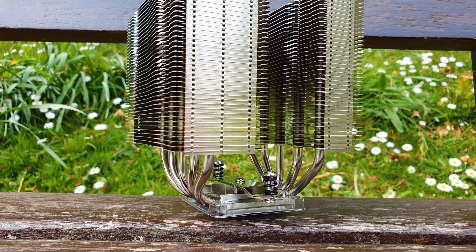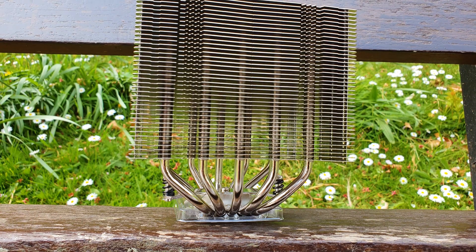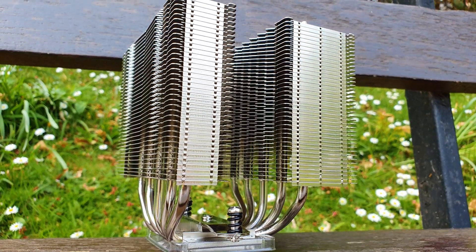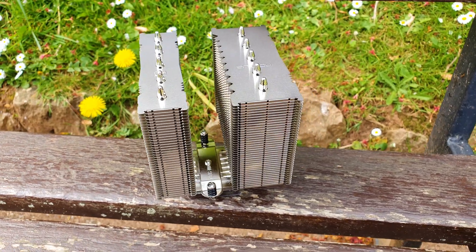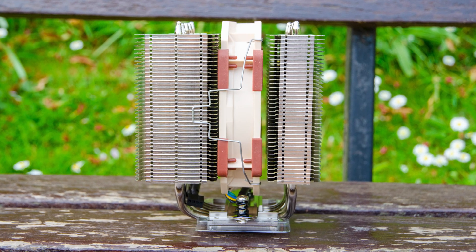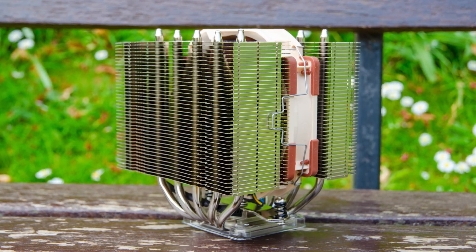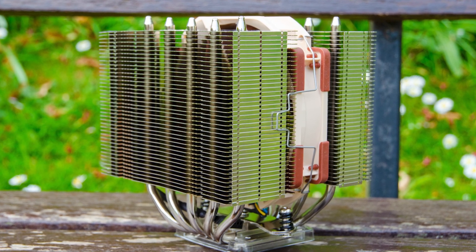One of the key features of the D12L is its low height of just 145mm, where most 120mm coolers are between 150–160mm. It weighs just 700g without the main fan, or 890g with it in place, while being 113mm in depth, 138mm with a potential second fan, and 125mm in width. In order to offer full RAM compatibility, it uses an asymmetrical design for its dual tower heatsinks. Hence, if adding the optional second fan, you must be prepared to use memory modules with low profile heatsinks.